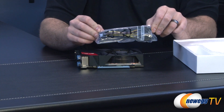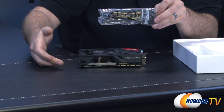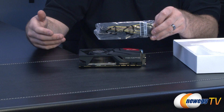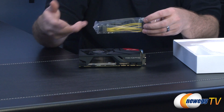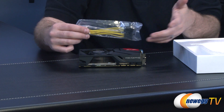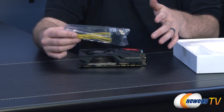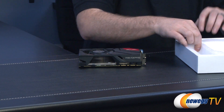You get a power connector cable — this card uses a single 8-pin PCI Express power connector rather than two 6-pins like the reference design. That is actually the same amount of power: an 8-pin gives you 150 watts, and the two 6-pins are 75 watts each. So it's effectively the same, but if you have a power supply with only two 6-pins you can combine them into a single 8-pin using the included adapter.